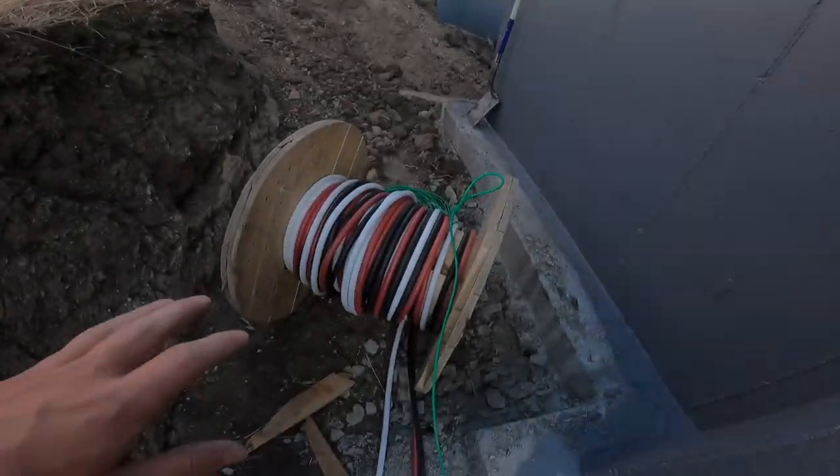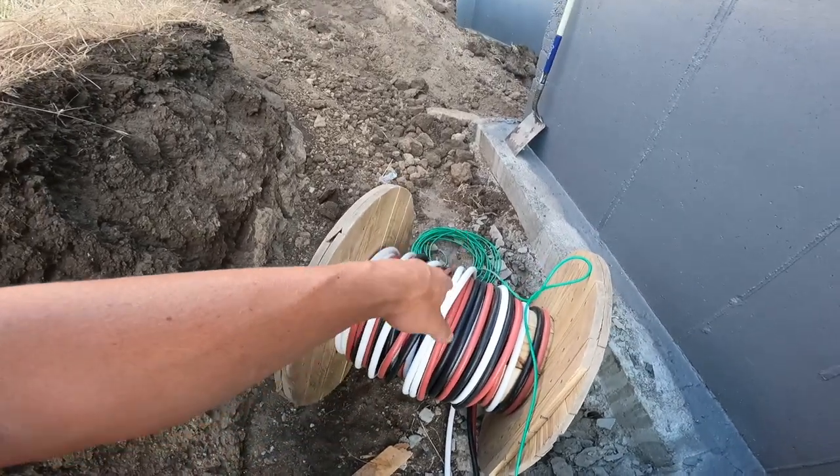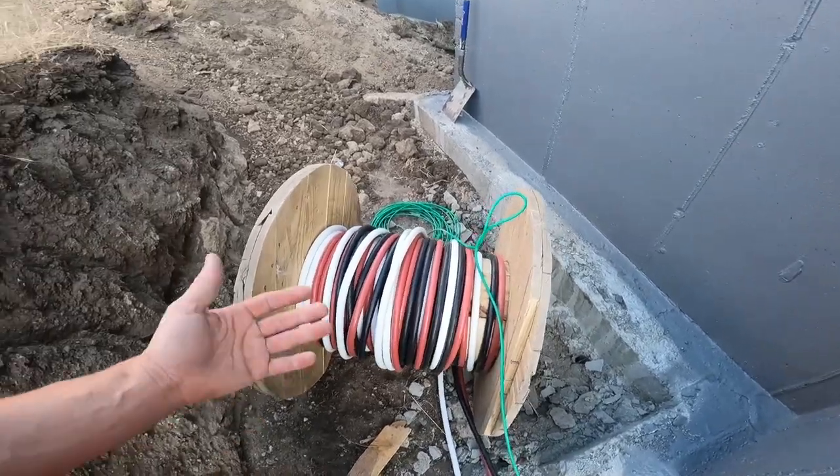Sleeves are all off. I learned — because I thought I was being smart — I started by putting the bell housing end first, thinking the wider beveled opening would flow easier over the wire. I was dead wrong. The bell housing has a sharp edge right at the opening that kept catching on the wire, which worried me about potential shorts. When I pulled them back off I pulled through the male end, which has a small internal bevel and let the wire flow right through. Lesson learned — male end first.